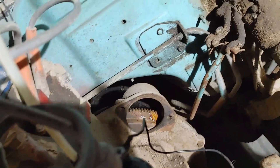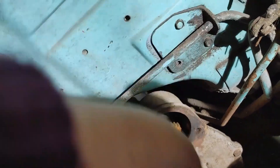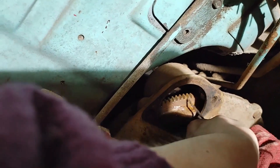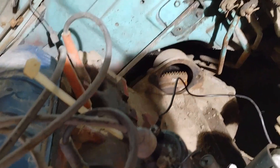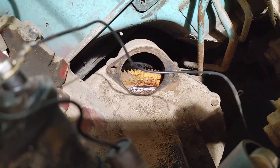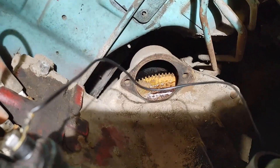I was spinning around to get the flywheel cleaned up and I find a couple big blobs of dirt in there. So what I've got is a drill bit, and I'm just in here cleaning out every one of these little teeth so that the starter can turn through there without binding on any high spots. I'll just turn it a little bit and see what each little section looks like. There's a lot of debris, something going on there — a little bit of moisture infiltration. So we're going to get that cleaned up, and hopefully that helps with the starter binding.